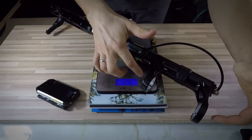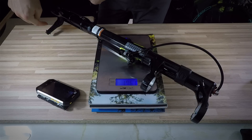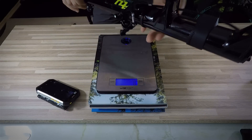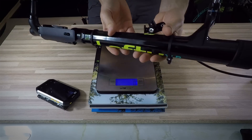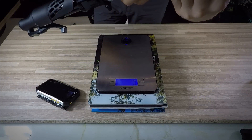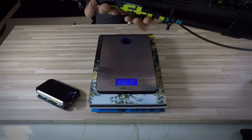This is the new spring upgrade. It looks awesome and we'll be talking much more about it in the future. It has the hybrid needle bearing system — we have needle bearings up here and a bushing down in the lower Lefty. No problem for cornering and stiffness. The needle bearings are in a squared-in system with uppers, lowers, and in between. The bushing works very well with the needle bearing. The whole system seals up nicely. There is much more to come in terms of Lefty testing on this channel.